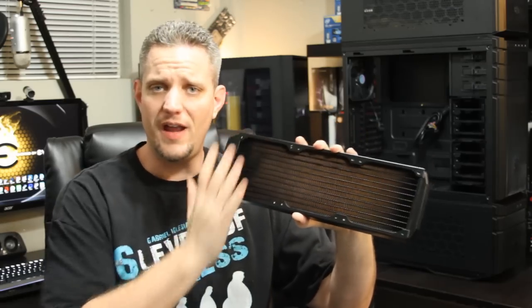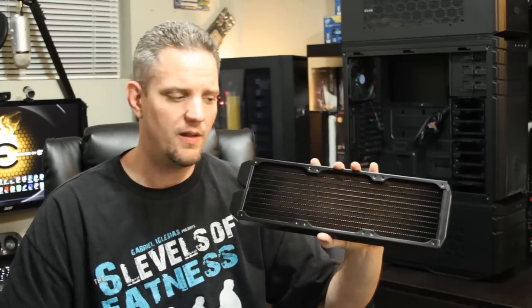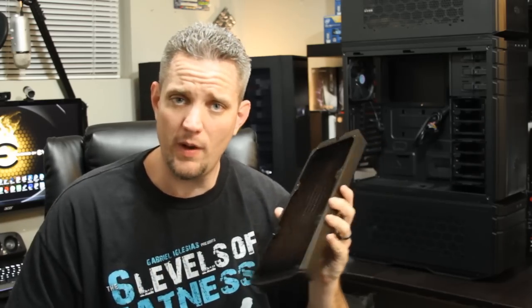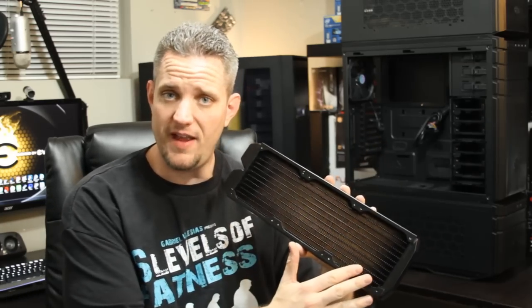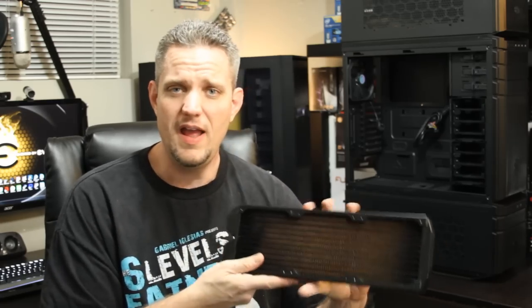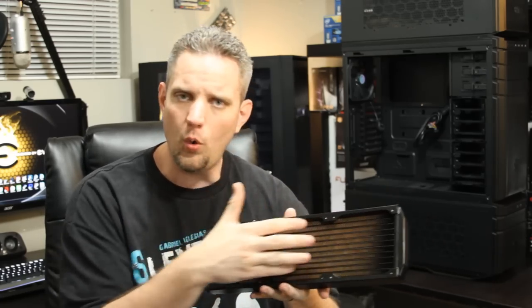What we're looking at here is a radiator, also known as a heat exchanger. All it does is take temperature out of fluid running through it. The interesting thing about radiators is even if you have no fans on here, there's a ton of passive cooling that goes on. My 900D behind me — if I turn all the fans off on the radiator and put the system under full load, it only runs about 10 degrees Celsius hotter than if I have the fans on, and it's still a lot cooler than air cooling.